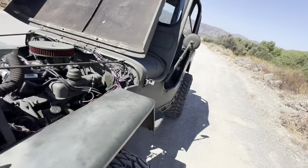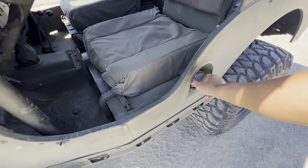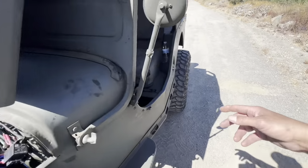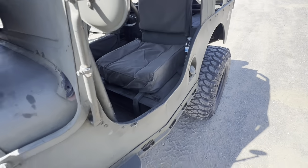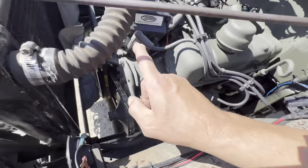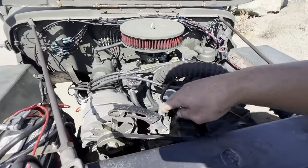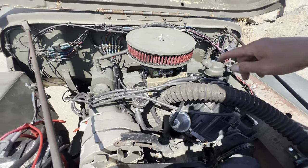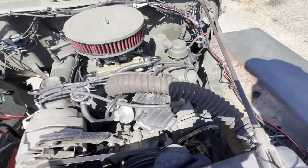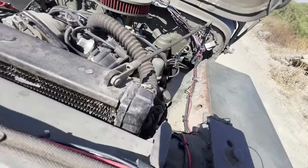Same thing, I use the stock gas tank. Turn and Burn showed us how to do it with the inline and the return line. There's two hookups down there at the bottom, and that's how I did it. I just ran the fuel. You can see it down here. Ran it up where the stock one is, right underneath here in the middle, and came back up like this, and this one that way. Not too sure I'm gonna leave it there though. I might bring it back around this way. It's a tight fit in there, but it is working pretty good.